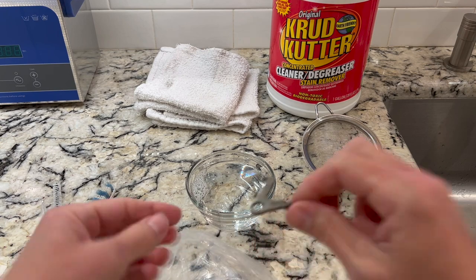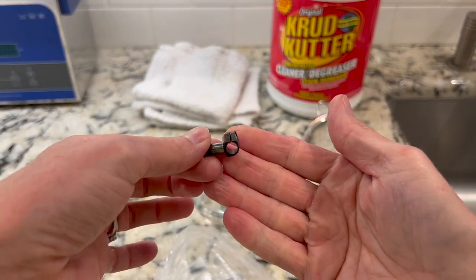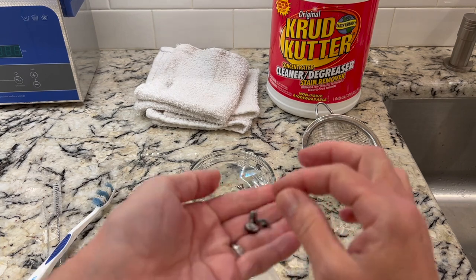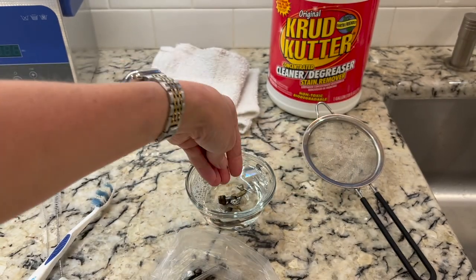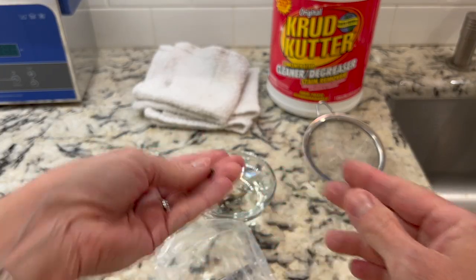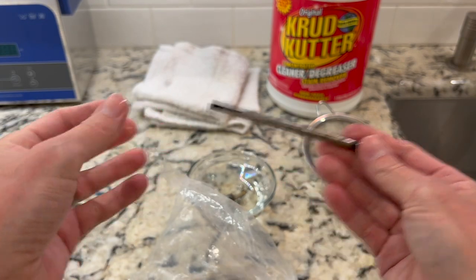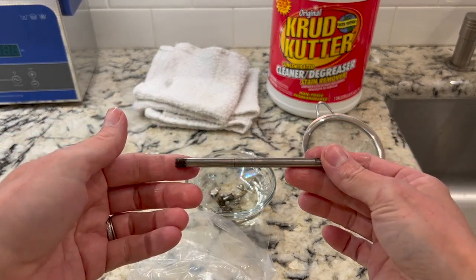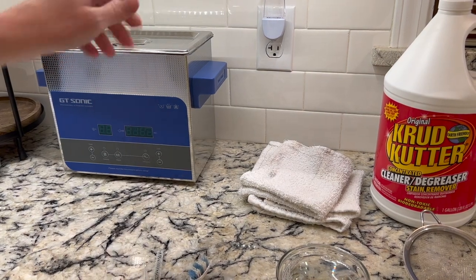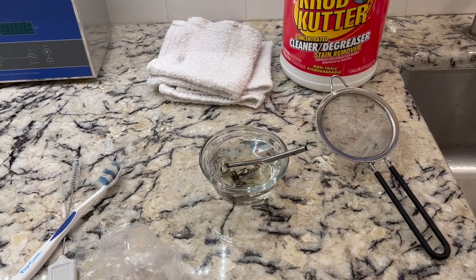I chose parts from the needle bar and the tension pin releasing lever and I'm placing them into the cleaner — you can see how dirty they are going in. Keeping just a few parts at a time really helps you not mix things up, so I tend to do one bag of parts at a time since they're already separated out. The needle bar is a little long for this bowl, so I'll probably put it in the ultrasonic cleaner in a moment.